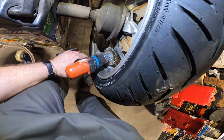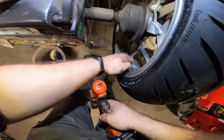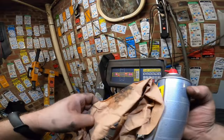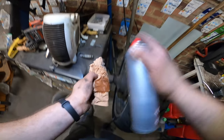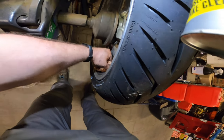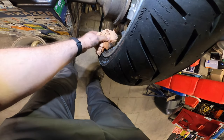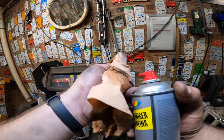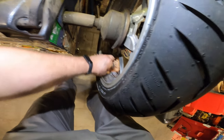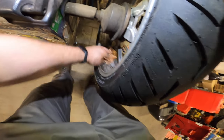That's what I would do with a car. So you take your brush and just ever so lightly you would clean up the rim. I'm just doing it on the glue part. So you break the glue off a little bit, you go back to your brake cleaner, that will make the glue come off as well. And now a little bit better because we damaged the glue, as you can see. The glue becomes gooey. So this rim will be good to go with this technique, and with some elbow grease, of course. That's how things happen in life, with elbow grease. Well, there we go, pretty clean.